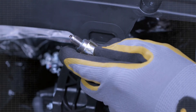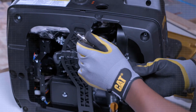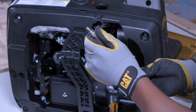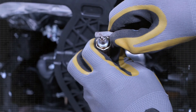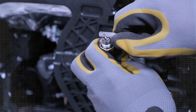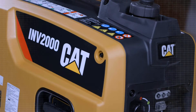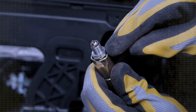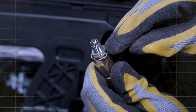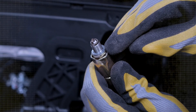Remove the spark plug. Visually check the spark plug. If the insulator is cracked or the electrode is damaged, replace the spark plug. Measure the plug gap with a feeler gauge. Adjust the gap as necessary by carefully bending the side electrode. Refer to specifications in your owner's manual for the correct gap for your product. Check the spark plug washer to ensure proper working condition. If the washer is damaged, replace the washer.